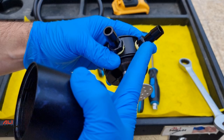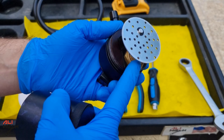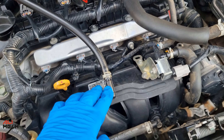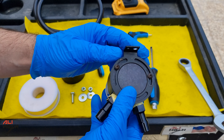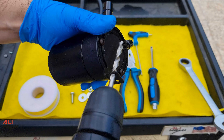The inlet for the oil catch can will be here — after passing the PCV valve, it will strain the oil vapor from oil drops and keep it underneath, then it will filter the oil vapor and comes out from here. After the oil catch can it will go back to the intake manifold. So the inlet will be on this side and this one will be the outlet. We also have this sliding so we can twist it and have a better angle with the hoses.